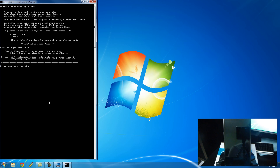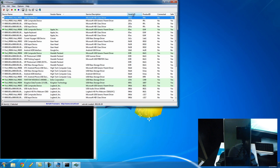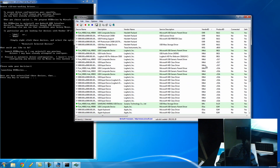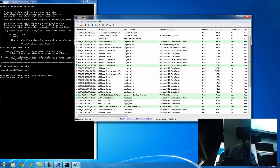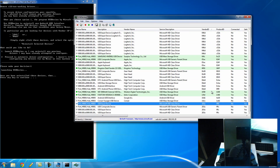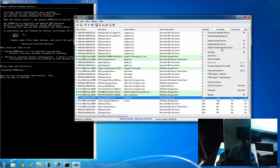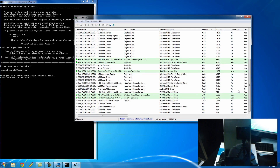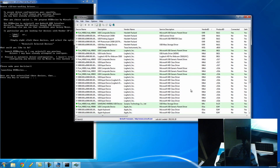So now it's popped up. It's just going to make sure that there are no old drivers installed. It says we're going to look for 18D1 or 04E8 on this next screen. So let's go ahead and check that. I'm going to go ahead and click 1 to launch this, and look for 04E8 under the vendor ID — there's none there, no 04E8. And 18D1 — there's one there, so I'm just going to right click and click uninstall selected devices. So if you saw any others, make sure you click those as well. I'm going to go ahead and uninstall that, make sure I've got nothing else — I don't.